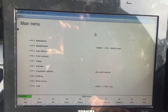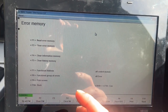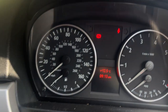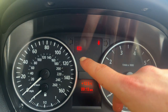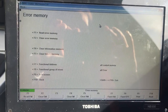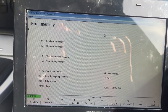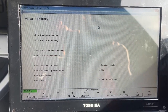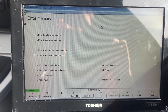Under the menu you can press F4 for Error Memory and then Read again to make sure they have all cleared. I've got two remaining: one is seat belt and these are my brake wear sensors. They aren't going to go off because I do need to change the sensor. But that is all you need to do for a very simple diagnostic scan using INPA. I hope that helps somebody, because I struggled when I first got INPA. Thank you very much.